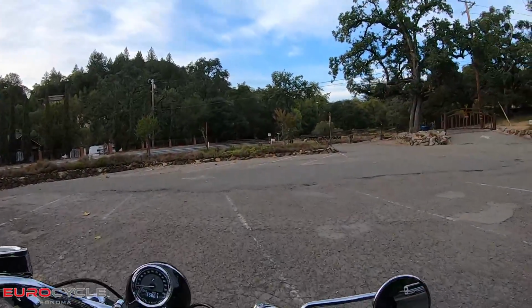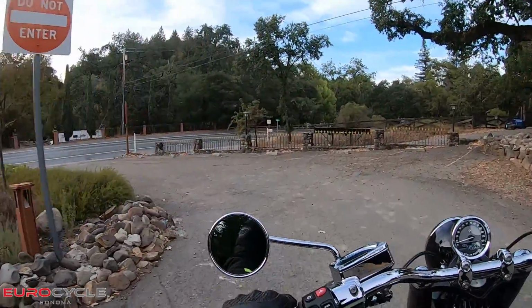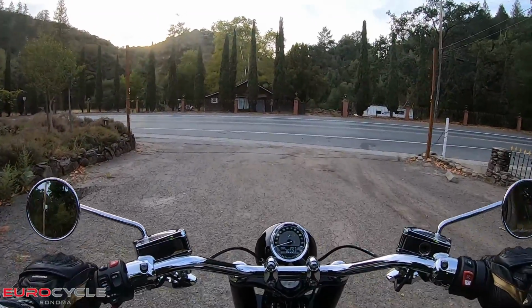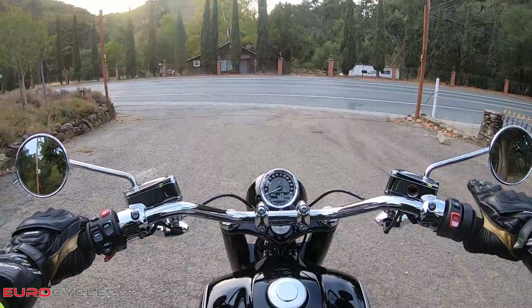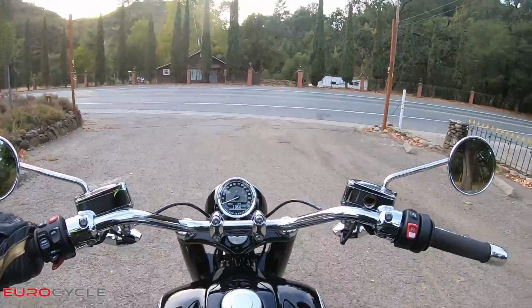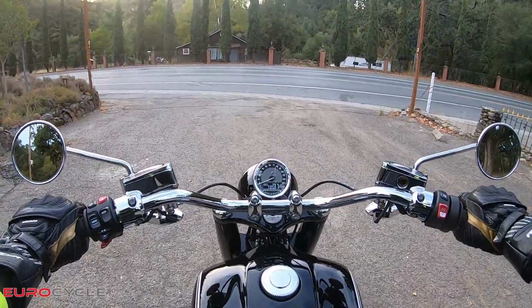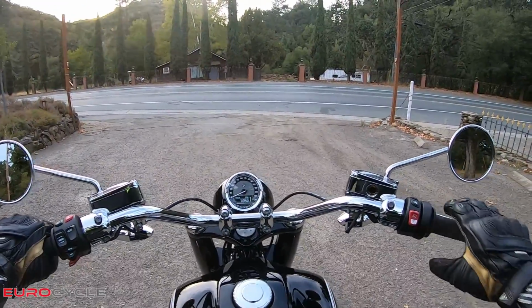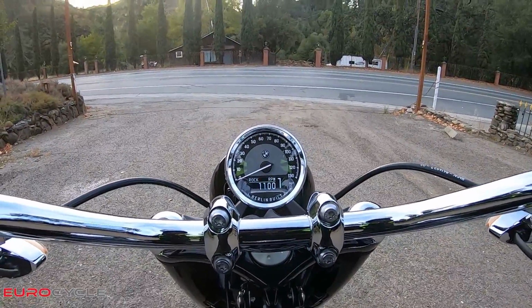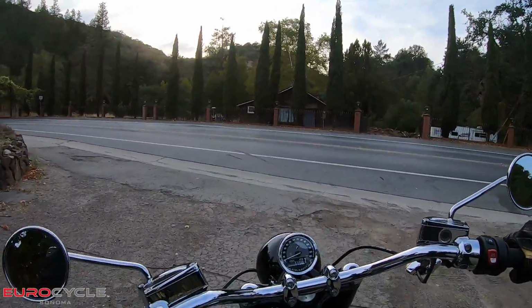Oh, this bike does have hill assist. So very nice with a down or uphill. What we're going to do is we're downhill and we're just going to give the brake one quick pull. And we got the H, so we've got hill start. So we're braked. Couple ways to release it. Obviously, release the clutch and the bike starts to go. Or just grab the brake again and it lets off. It gives you that warning coming off, and there we go. So hill start assist, very nice, especially on this 760-pound beast.